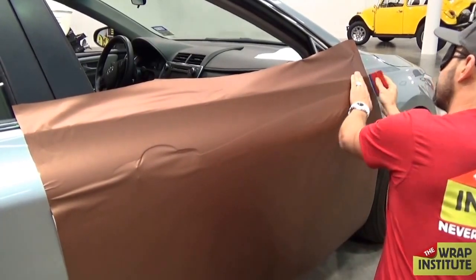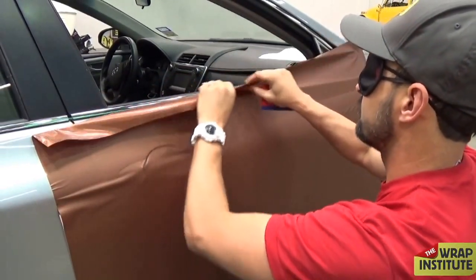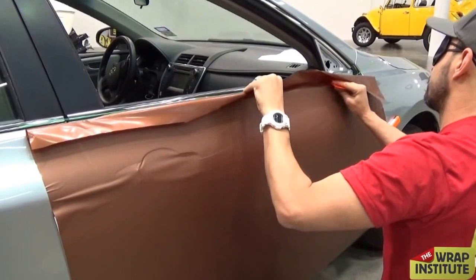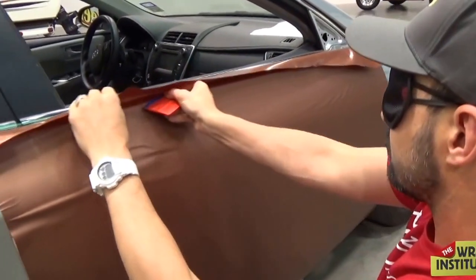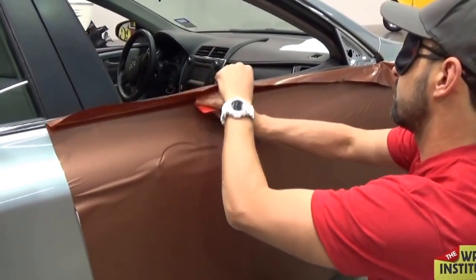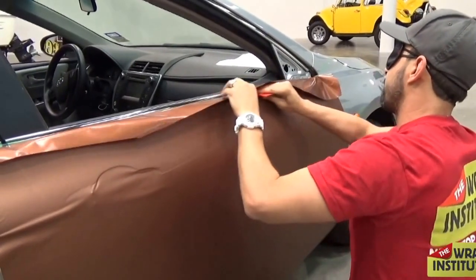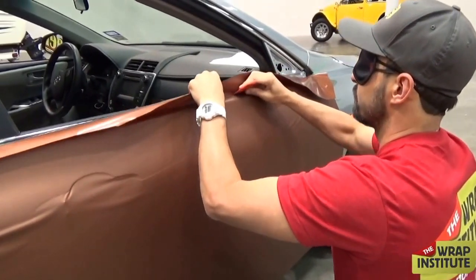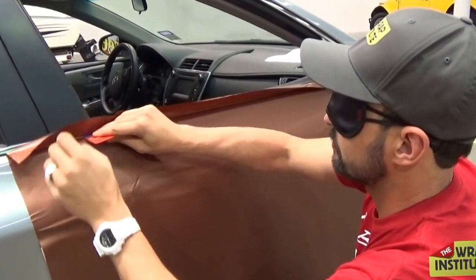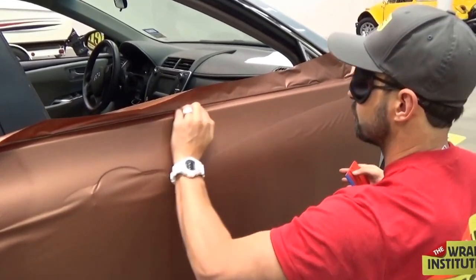I squeegee across, overlapping my squeegee strokes. My backhand is feeling for quality — a little bubble right there, I press it away with my finger. Squeegeeing across, nice and even, using a soft squeegee with a brand new felt buffer on it. Nice and straightforward, round the corner at the top — I don't want to use too much squeegee there. There's that raised object with the chrome, so I pull it and do the tuck and cut, tucking it all the way into the top. Long horizontal squeegee strokes at 45 degrees. My free hand now are my eyes — it gets a feel for the film, and if there's tension on the squeegee, it sends a signal and I tuck the material away. Tucking into the base of that molding with no tension, then run it across the knifeless tape.